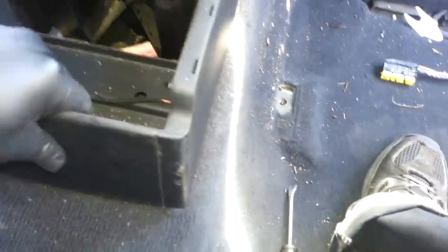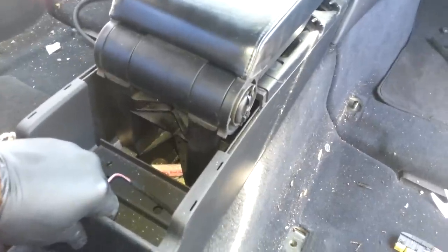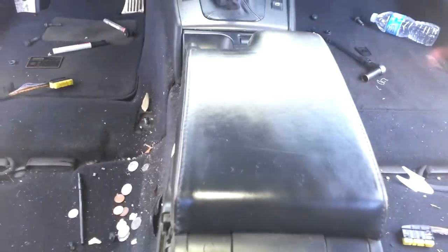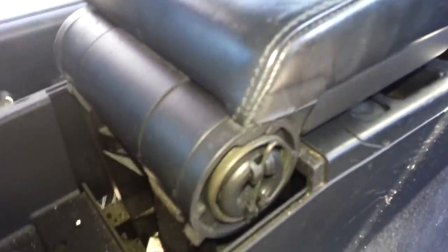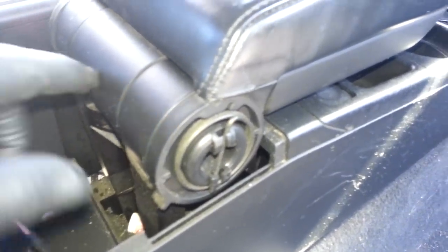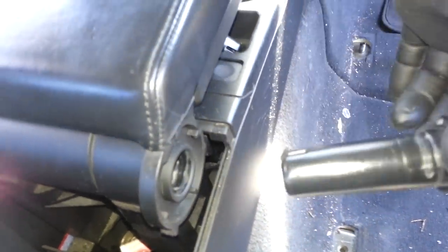Now it's getting loose and almost comes off. What's preventing it from coming off completely is the armrest. In previous videos I've shown how to remove armrests, so I'll summarize. You've got clips on each side — remove the clip on this side and the one on the other side. Once you remove those clips, there's a tubular holder you're going to pop out. Once you pop it out, the armrest is going to slide off. The clips that you remove from the side look like this, on both sides, and this is the tubular holder that you pull out.